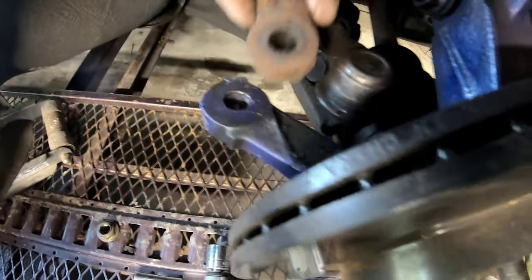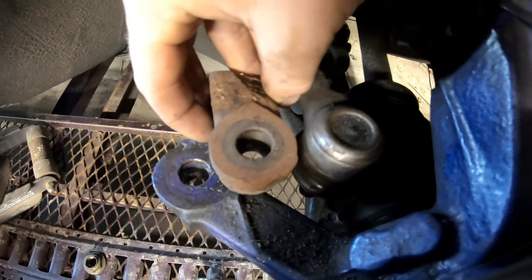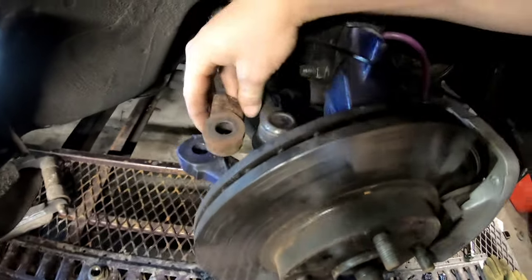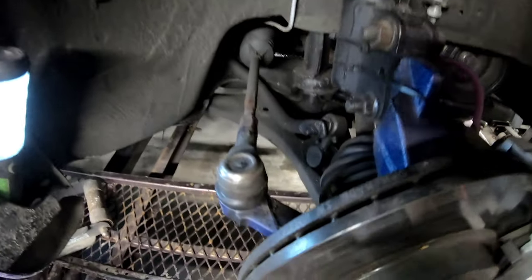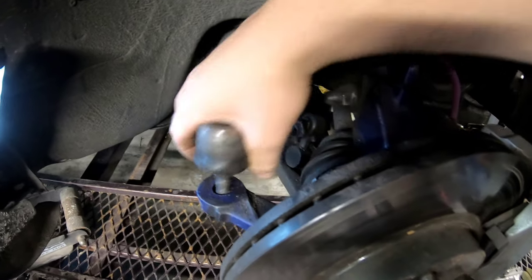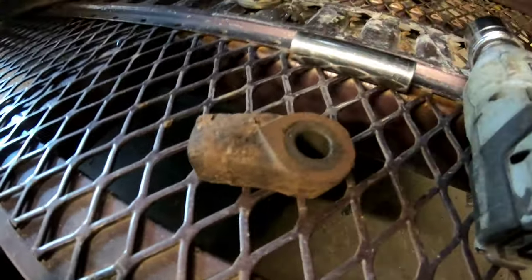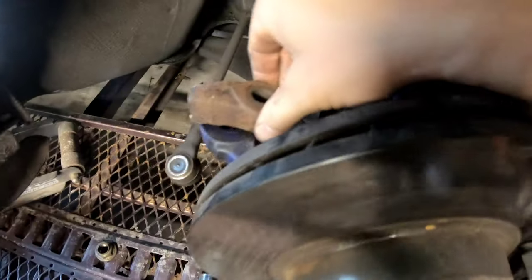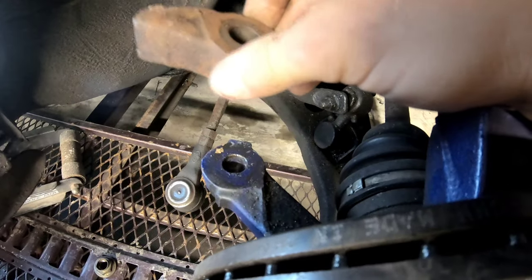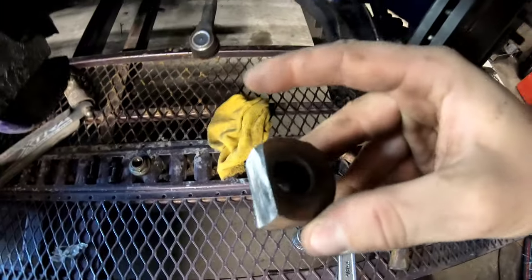I'm literally putting this new hole right beside the existing one, so the pendulum is closer to the hole the tie rod sits in, giving me a significant amount more angle. What I'm going to do is grind away and pocket this piece right into here, get it exactly where I need it, tack it, then fully weld it, and test it. The biggest thing is I want the steering wheel dead center and have the tie rod move to the new hole without the hub moving at all. I was lucky enough to get this off a donor car from my buddy, which was a huge help.